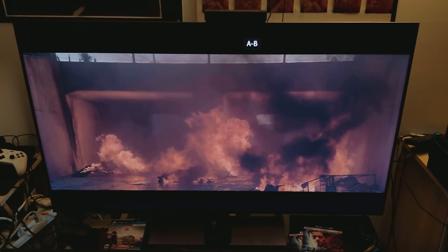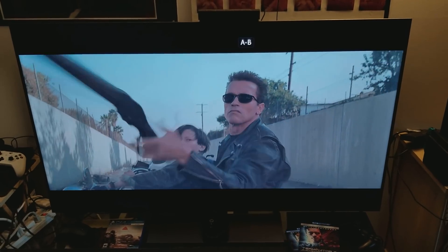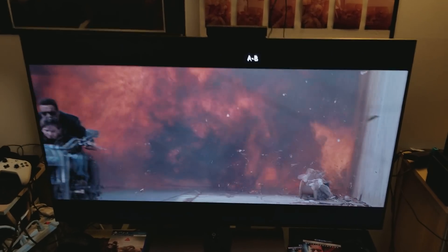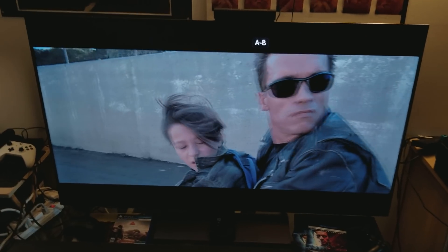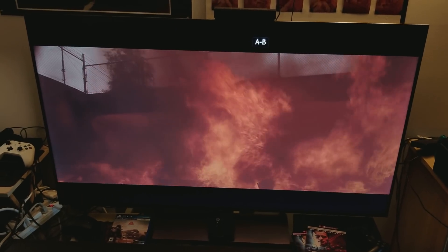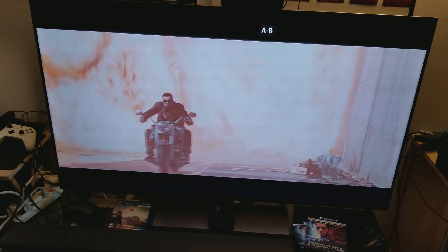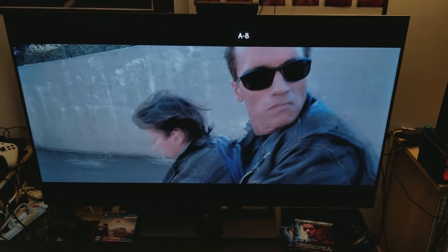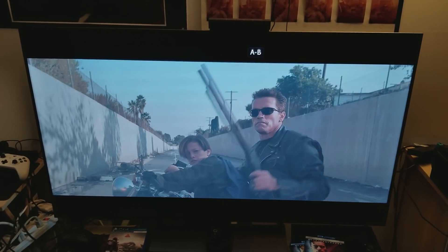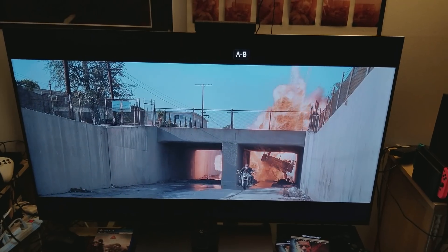But once you turn off the lights and start watching from an angle — sitting on a sofa chair off to the side — you will notice that bleeding light, especially on a 75-inch KS8000. The same goes for the Vizio M-Series, which is also edge-lit. Thank goodness Samsung is not going to be making any more edge-lit TVs, and hopefully no one else will either. Edge-lit should be avoided — full array local dimming with as many zones as possible is the way to go for LCD LED.